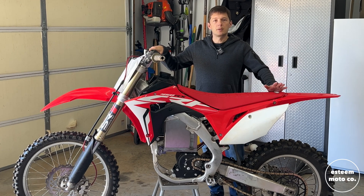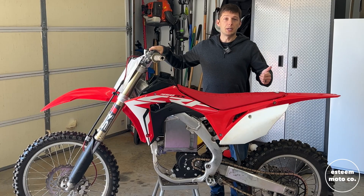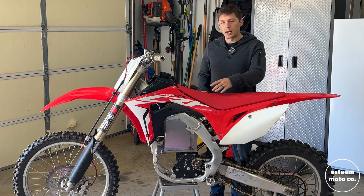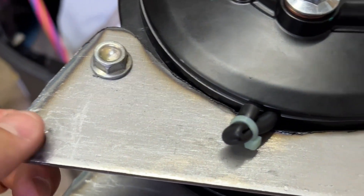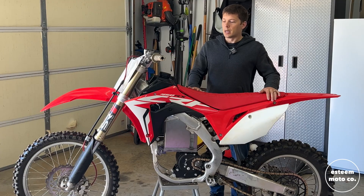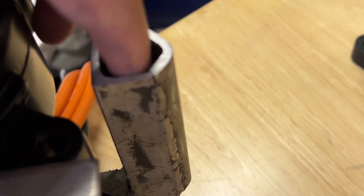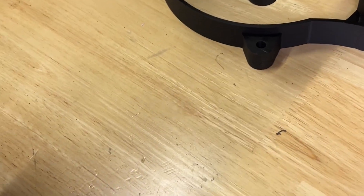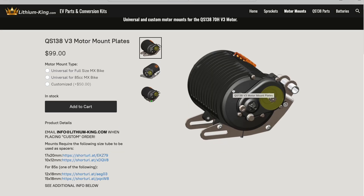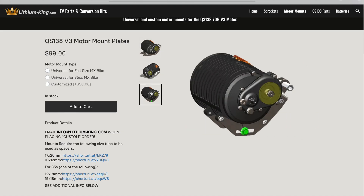Number two: this build took me around 10 to 11 months, largely because I didn't have a lot of time each day — just a few minutes here and there. I also wanted to build all the mounting brackets from scratch and learn to weld, which I did. I bought a welder off Amazon — link below — and bought steel from Lowe's and Home Depot. I made the motor brackets from scratch. Now, knowing what I know, I could build another in probably 10 hours. One thing I would do is buy pre-made motor mounts from somebody like Lithium King — I'll add a link below — that already comes with motor mounts specifically for this motor, mounting to the swing arm bolt in the rear.